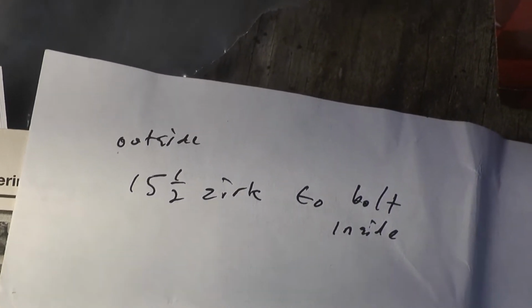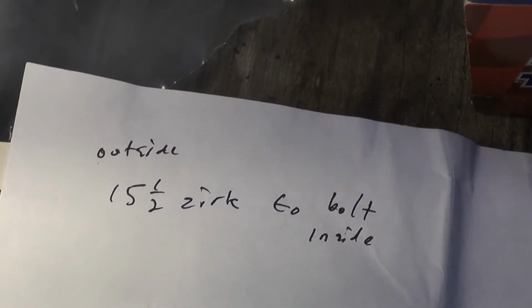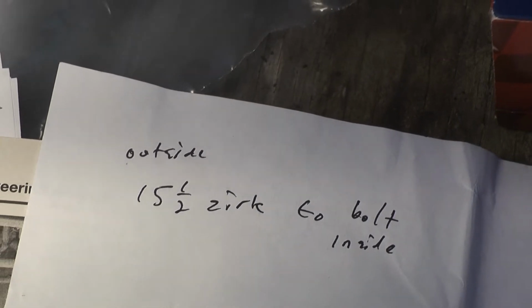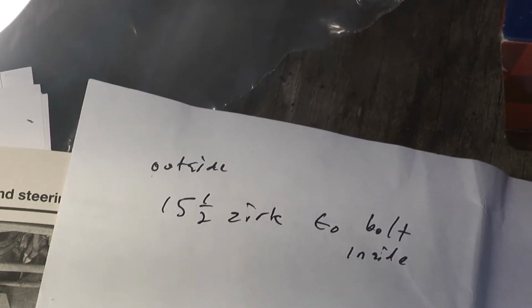Also over at the AutoZone, Trevor from Rhineland AutoZone, the manager guy, was saying to just put the wheel together, even though it's broken apart, and then measure that distance. Put it back to where it was before, so you know about where it was when you put it back together, because otherwise your wheels will be out of alignment, your toe alignment.